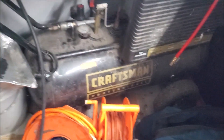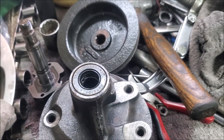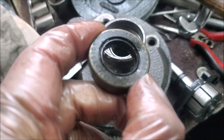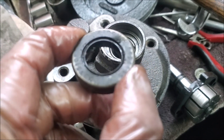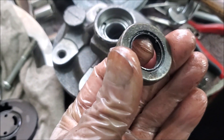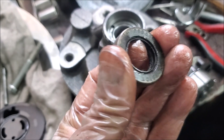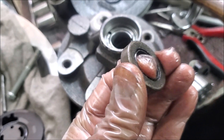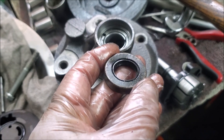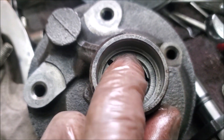It's out — actually it wasn't as difficult as I thought. I just used a pry bar and pulled it out. Probably the original seal in there. To be honest it was quite soft. As usual I'm always cheap and thought should I reuse it, but since the kit will come with one and if this leaks later the whole thing has to come apart again, I thought okay — pull it out. This is actually the lip face, which seems different.